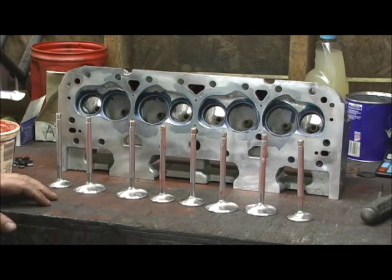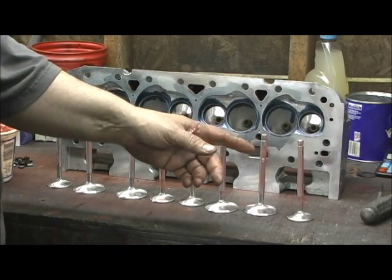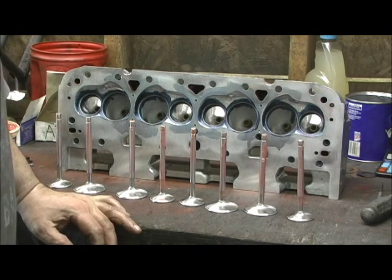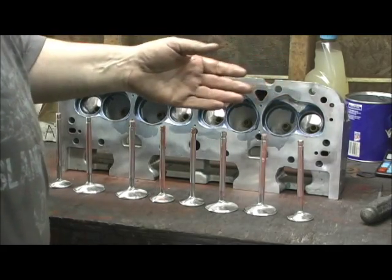The other reason I do it is because I set my valve guide clearances tight — a lot tighter than what most people do. If you set them up tight and lubricate them properly, you're going to have majorly extended valve guide life, which means valve seal life for a long time. A lot of shops won't set them up tight because they don't want the chance of a stuck valve — they just want to run a diamond cutter hone through at a certain size. They'd rather have them loose than take the extra time. These were all hand-honed.